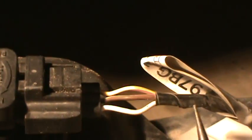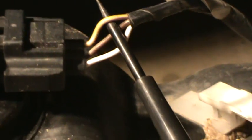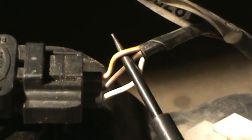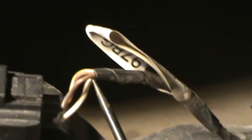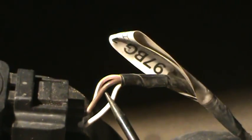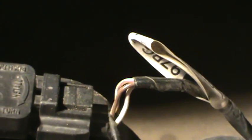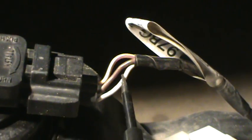We identified it — let's go over it again. Yellow and violet is this wire right here — that is the five-volt reference, and we should see five volts on there. Brown and white is the ground. White and violet is the signal — we should have a voltage signal there that varies depending on the pressure. We should have a good ground here, less than 100 millivolts when it's activated — key on, engine off. And we should also have five-volt reference on the yellow and violet when the key is on.